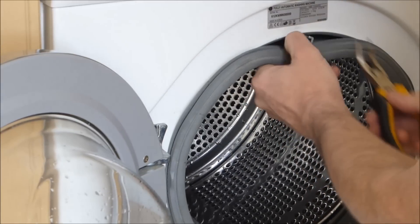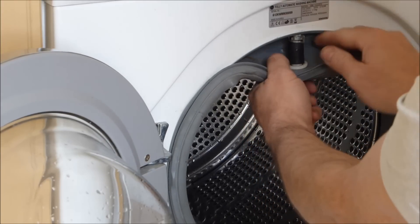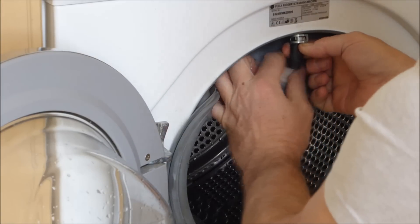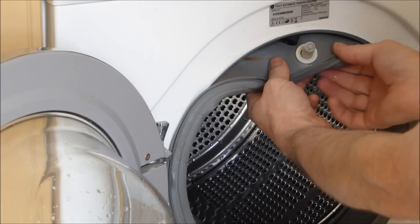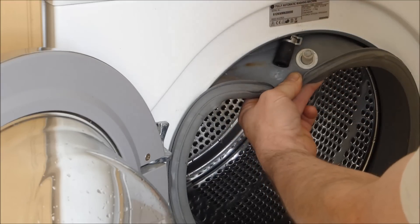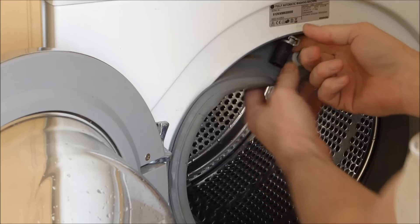All I'm going to do is remove the clip, slide it up the pipe. Next thing is to pull on it and get the jet to retract from the hose. I don't know if it's going to show up on camera, but there's some crap in there. What I'm going to do is get that out and also check out the hose.